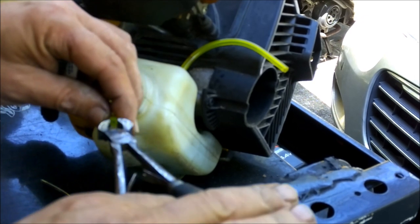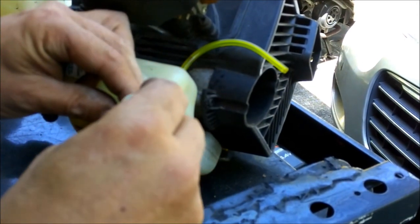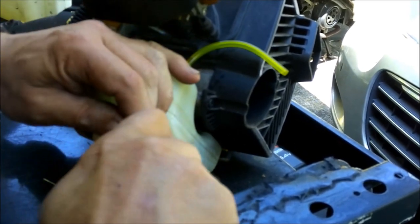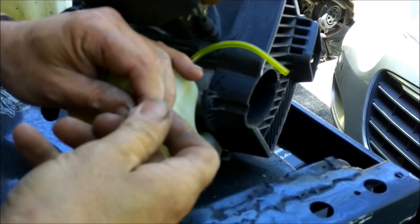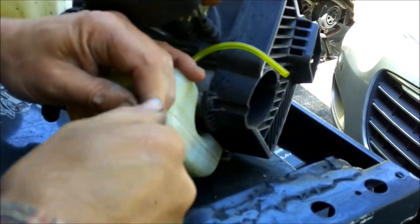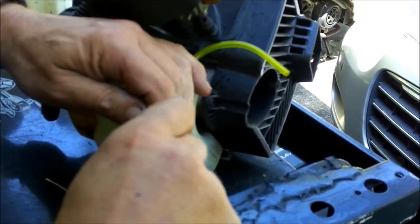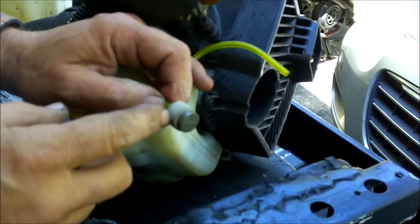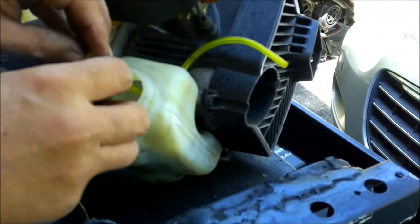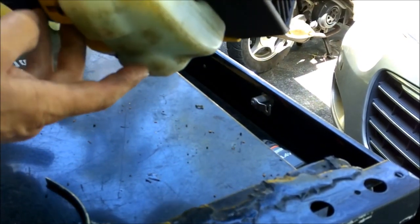So what I'm going to do is after you've cut that, cut it off straight — get as straight as you can. Put your filter back on there. If you've got to use a little lubricant it's fine. I wouldn't use petroleum jelly or anything like that, but a little bit of WD-40 will not hurt it because like I said it's a two cycle engine. Now you want that on there fairly snug to keep it from leaking. I'll blow through it. Okay good. It's down right there at the bottom — that's where you want it to land.